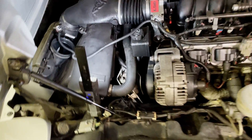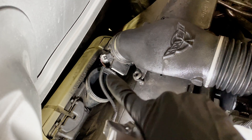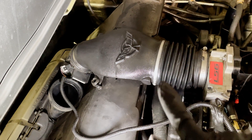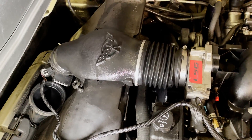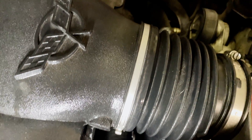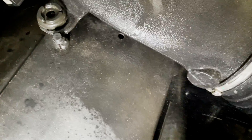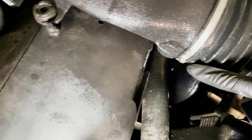After about half an hour of thoroughly looking over all the connections, I ended up capping off the mass airflow sensor with a glove and testing that portion separately — I had kind of brushed it aside and didn't think it would leak. But when I spray some soap on here, you can see that it is in fact leaking at this connection. So that's what a leak is going to look like. I just need to tighten this clamp and then we should be good.